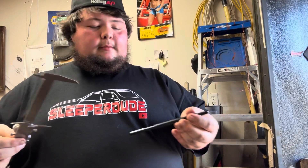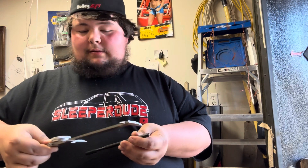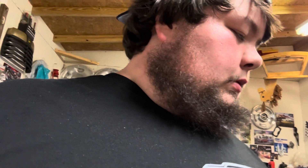Right now we've got our dial set at six inches - nowhere near big enough. Our dial wasn't long enough so I grabbed a tape measure and measured that checker tool out and it was six inches and 23/32nds, which if you break that down is 720 thousandths. So our intake side is going to need 6.720 pushrods.